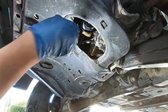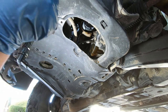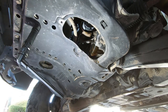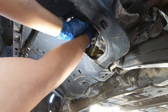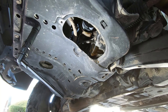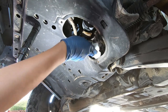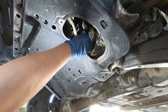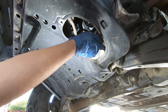You should be fine. These oil filters only need to be hand tight — do not use the wrench on these. If anything, use a clean paper towel since sometimes your glove is kind of oily, and tighten it up with your hand. As long as it's snug, you should be okay. Next thing you want to do — because you love your car — is wipe it down a little bit and take off all the oil that spilled here and there. Those quick lube shops probably won't do this for you out of love.